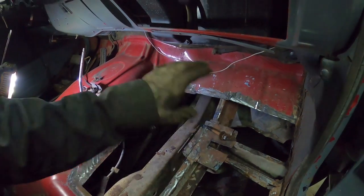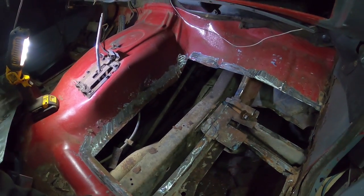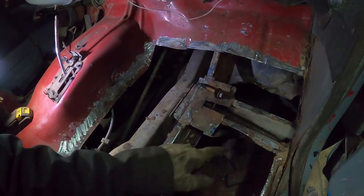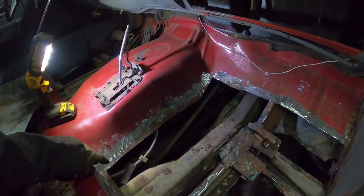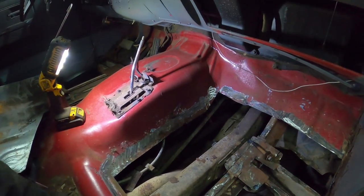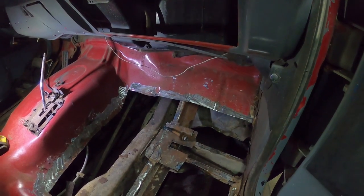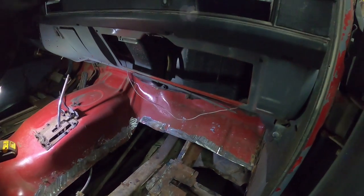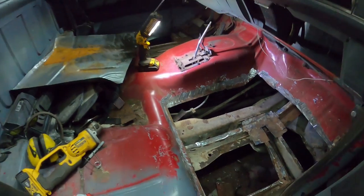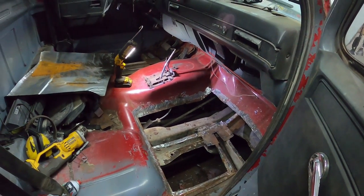So I'm just going to put the floor on, I'll mark this thing here, give her a few plug welds to hold it. Same thing across here - plug welds. And then when I weld it around there I'll kind of trim out the excess, it'll fall out the bottom side, seam seal it, be done with it. It's getting to be about midnight. I've got all the ugly stuff done, so I think that's probably a good point to stop.